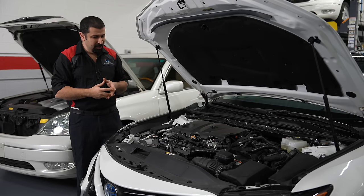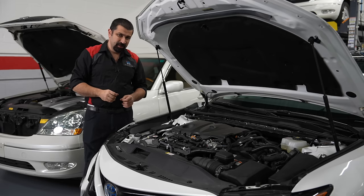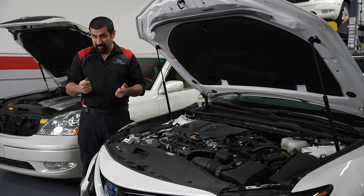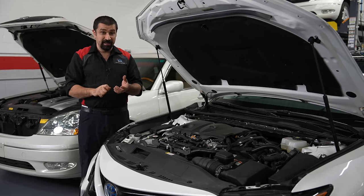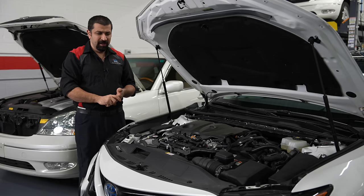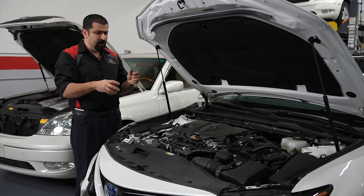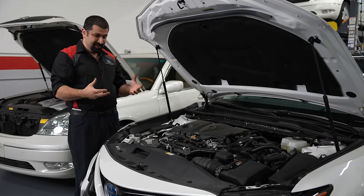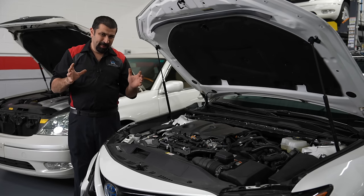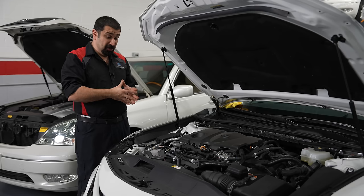With hybrids, if things got out of hand, use a broad spray and dry right away. If you suspect water got into a connector, disconnect it, use compressed air to clean it, then use electrical cleaner to ensure everything is out before reconnecting. The fifth generation hybrid has the same principles — don't direct water pressure at inverters. Your best bet is to spray and wipe down; that is the safest approach.